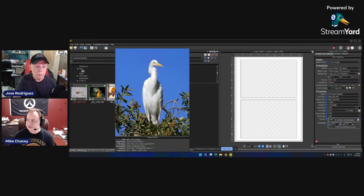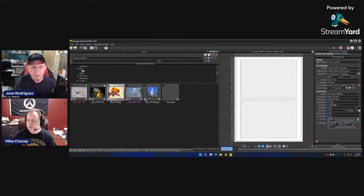If somebody chose to print this image and says they're exercising their printer, well, that'll exercise cyan and a tiny bit of yellow in the beak. Not much magenta, and not a whole lot of red or black ink. But that unclog pattern is balanced. It exercises every color the same amount. So that's why it's more like a custom pattern, because you're picking the actual colors in the ink palette of your printer. So I think that covers it. That's awesome. Great. So that's how you do that.